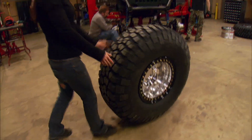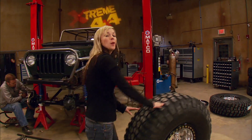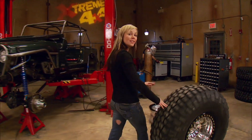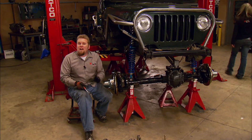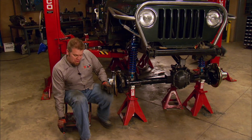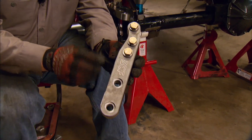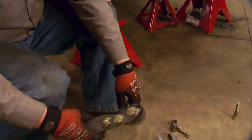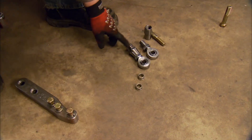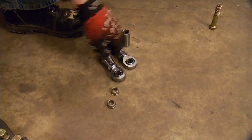Welcome back to Xtreme 4x4. With our Jeep's new axles mounted in place, we can go ahead and slip in a set of wheels and tires. But before we do, we're going to have to deal with the steering. We had Blue Torch Fab send us one of their Dana 44 High Steer Kits, which comes with new billet upper arms, conical washers, misalignment spacers, and tubing adapters for QA1 rod ends. All we have to supply is some DOM tubing.